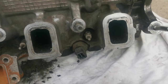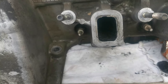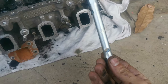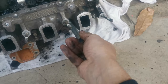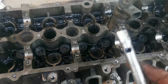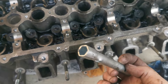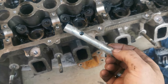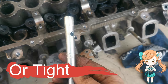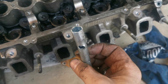Next up, let's proceed to remove the glow plugs. I've got this tube socket set — I'm going to put the tube socket on and then take them out. I cannot believe that this tube socket is so soft that it bends like this. Can these glow plugs really be so stiff that the amount of pressure needed to loosen them is too much for this tool to handle?